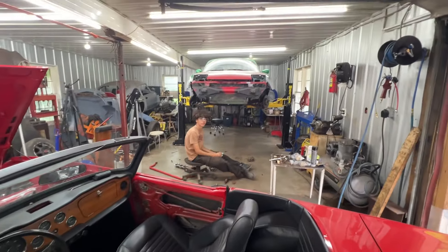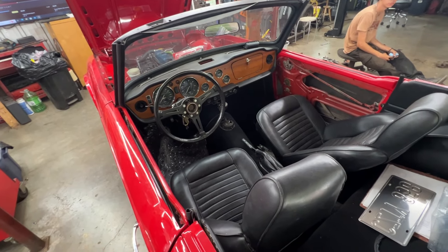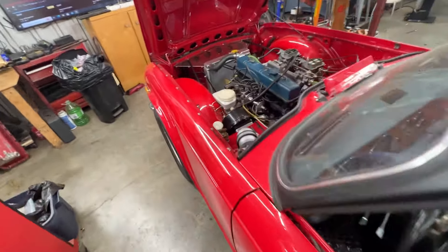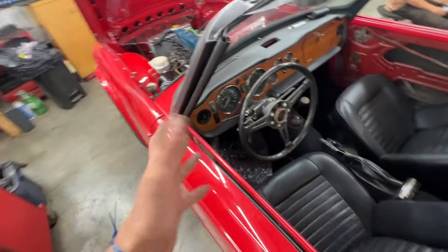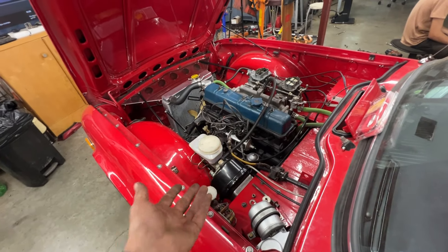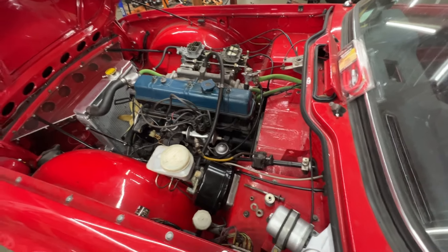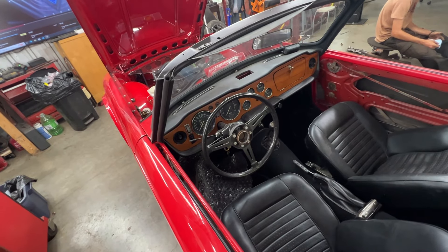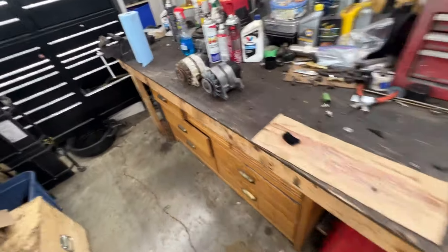Okay, it's another day. Nick is working on his Miata. I'm kind of tired of interior work to be honest — I know I have to run some wiring but I still don't have boots for the transmission cover, so I'm gonna leave that alone for now. But if you remember, we had a problem with the alternator. The problem was that the alternator was charging just fine, but the field wire was getting 18 volts, and the higher the RPM, it was going even higher than that. The output wire going to the battery was 13–14 volts — normal — but the field wire was getting such a high voltage, and the warning light on the dash was coming on while the engine was running.